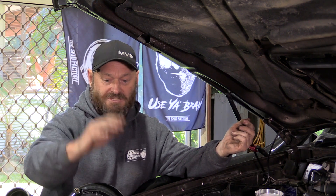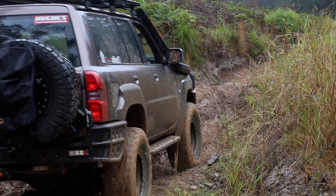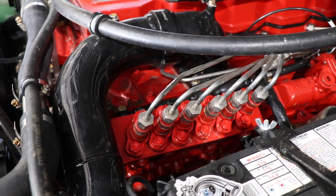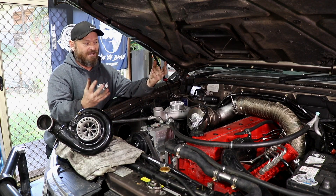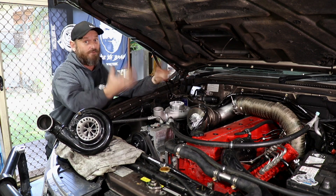Six mil doesn't sound like much, but that's massive in relation to turbine wheels. This one could make more power because the turbine is bigger and that's going to allow more gas flow, but the trade-off is it takes a lot more gas flow to light up, to get on boost. And that's where you have the problem with smoke when you hit the throttle — it just doesn't react very fast. A p-pump doesn't give a damn whether there's any air there; it just does whatever your foot tells it and puts fuel in. So that's where you get your smoke until things become efficient.